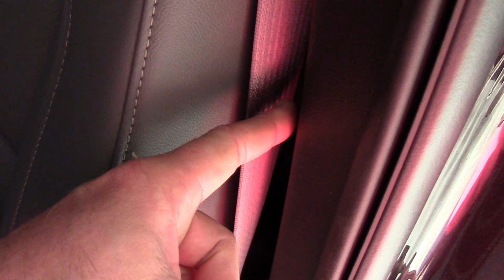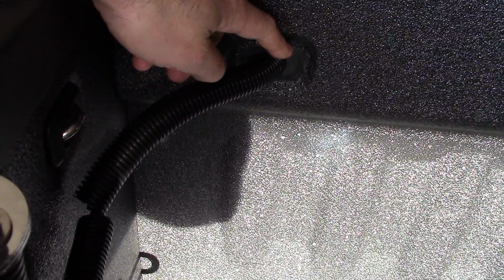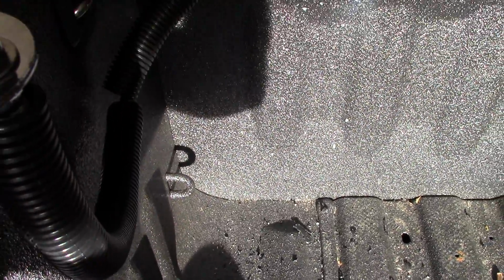Now for the antenna, I ran underneath here, and there's a little vent hole behind the bench seat here, and I just took my utility knife and cut just a little slot and just pushed the antenna lead through there in between the firewall and the bed, down in here into this little cubby hole deal. Now this is where I probably need to get creative with my video taking here, but here it is, coming through here and then up into the antenna here. This is just wire loom I have on here for now, and that worked out really good.